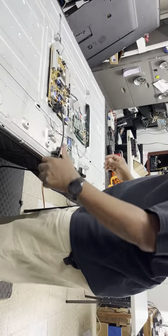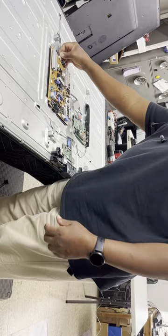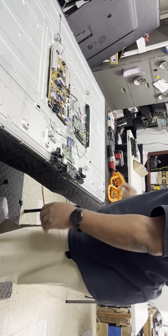So when I turn the TV on, it flashes the LG logo. Eventually it does show a picture, but if you pay attention, you're gonna see circled spots. That's where all the lens covers have fallen off. Okay, so let's get to replacing these LEDs. Pull the plug, pull the LED power, and let's disassemble this guy.